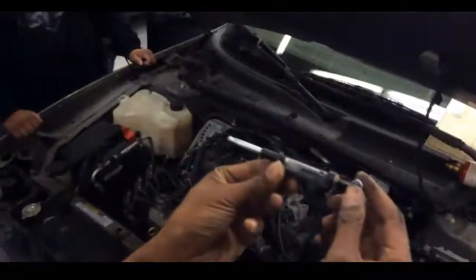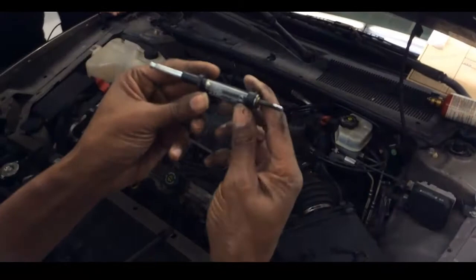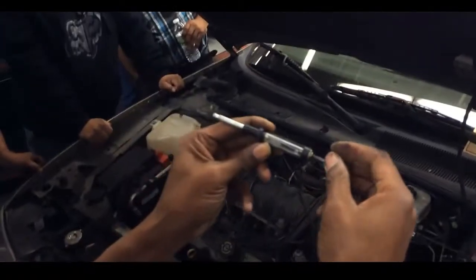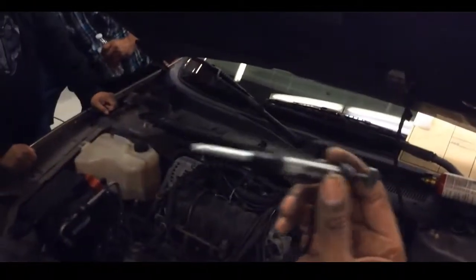Let me make a misfire. This right here is adjustable — I use this to check ignition coils. Sometimes you can have a misfire and still get a spark at this coil. This spark tester is adjustable. I used to set it like 25-30 kV. If this coil — this type of coil system, DIS — can't fire this, you could have a bad coil.